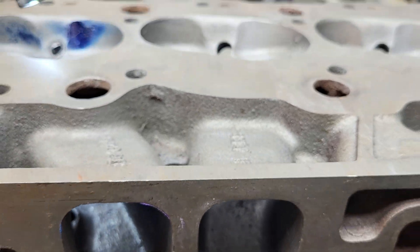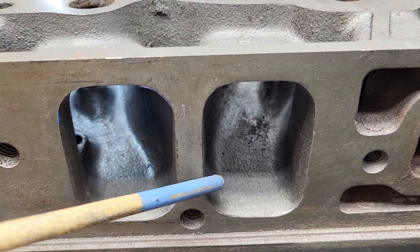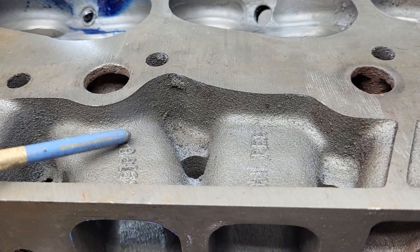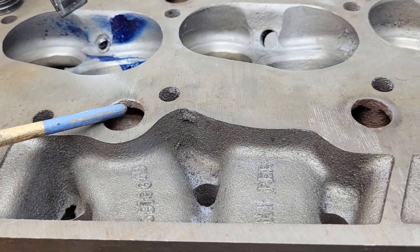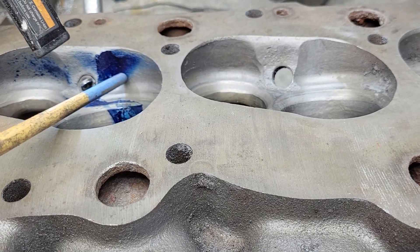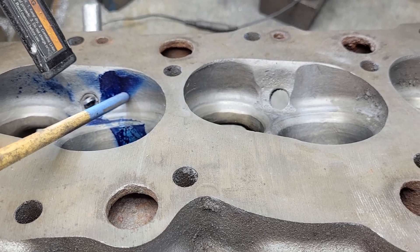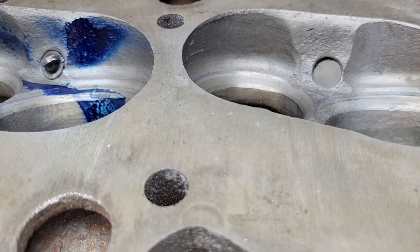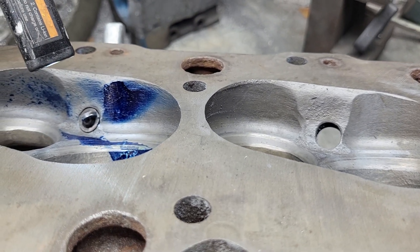The other thing I don't like about big blocks: they Siamese the ports here so the intake manifold has similar-length runners, but when they put the different ports in, these are different lengths. They're certainly going to have different swirl because they're aimed at a different angle in the chamber. Though according to my old port work, the swirl wasn't that different — not as radical as you'd expect.